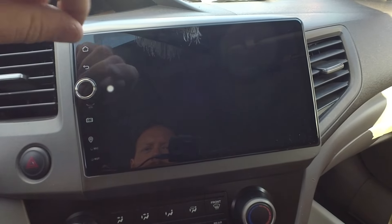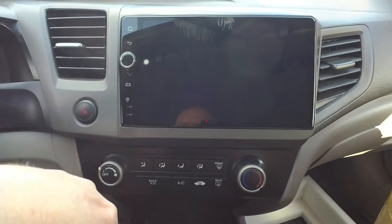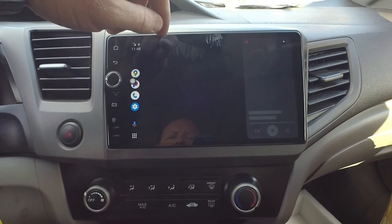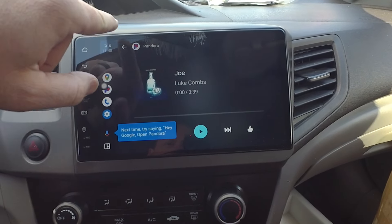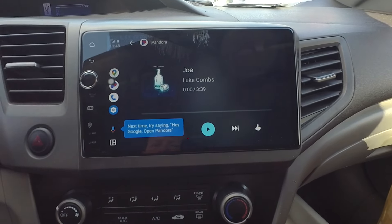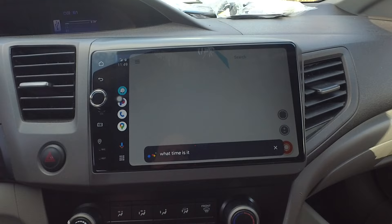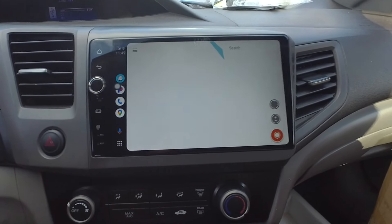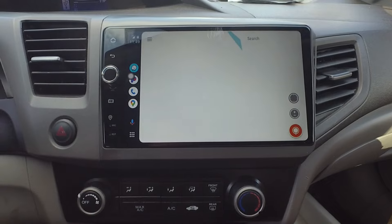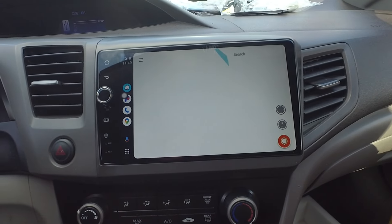This is automatically going to work for Android Auto or Apple CarPlay. I'm going to plug my USB-C cable into the port I installed below and open the CarLink 2.0 app. It says 'waiting for device to connect.' There will be some setup stuff you have to do on the phone — it's going to ask you to grant the permissions, just like any Android Auto setup. It just takes a second. New look to Android Auto functioning — Pandora automatically pulled up. That's how I usually run Pandora and a mapping app. You can also run Waze or any other applications. Everything works as it should — if you get a phone call, it'll come through. You do need to pair Bluetooth separately in the Bluetooth app; it does not pair Bluetooth automatically like some factory head units do.